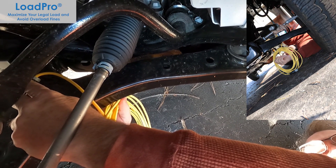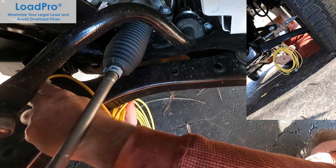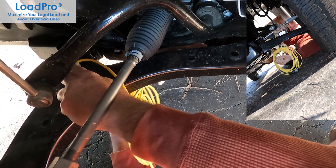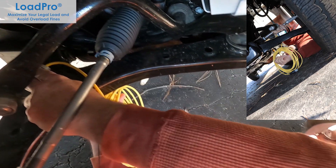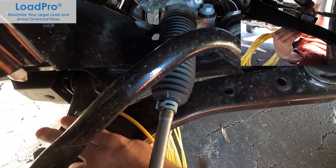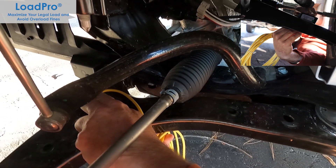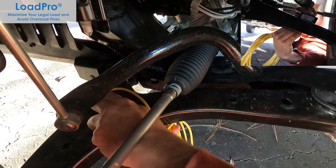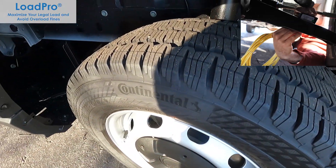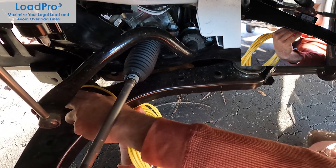The curing part is just to make it permanent — you don't have to wait for it to cure to do calibration. Once the sensor is set, you leave your wire straps on; they can be cut off or they'll fall off over time. Your 3M bonding tape is what holds it on — the straps just give extra pressure while curing. You could go ahead and calibrate the system within that four or five hour time period. Sometimes you look at the suspension and there are different places you can put the sensors; some give better and more consistent motion, while others may have rubber stops you want to avoid.